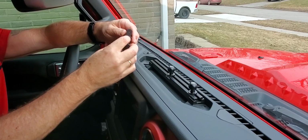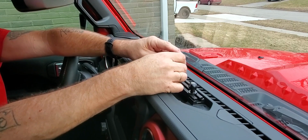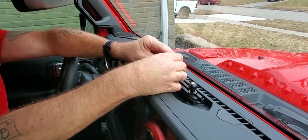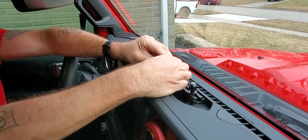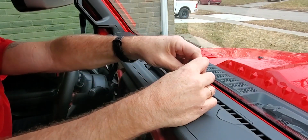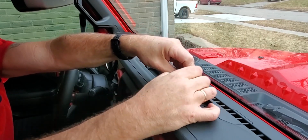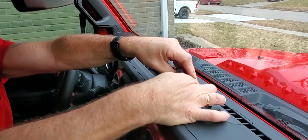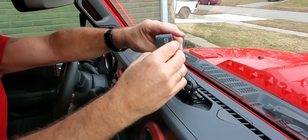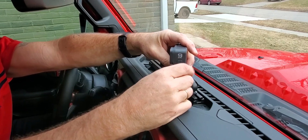With this installation, I chose to go with a dual GoPro mount setup in matte finish. To install, simply loosen the wing nut on the side of the mount, slip it over the track ball, position it into your spot, and then tighten the wing nut to prevent your GoPro from vibrating down the trail. Install the GoPro cameras to your desired angle, and then you're finished with this installation.